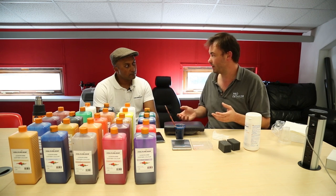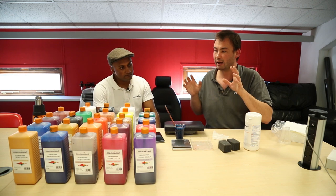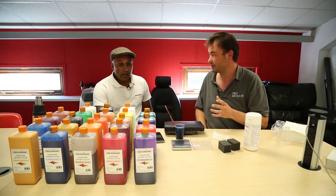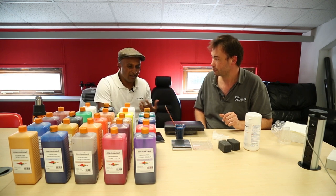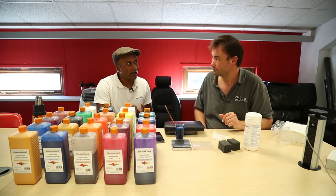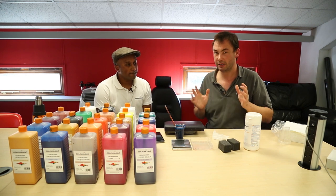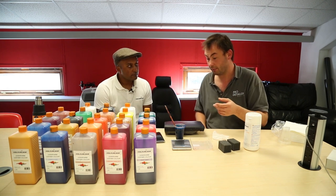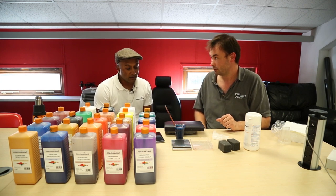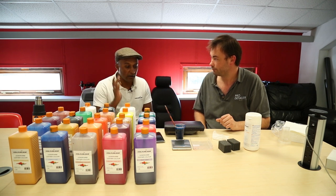What we're looking for are tools like decent scales, the app, and the consumables that work easily and well together so you can pick it up quickly. We did a shoot with Kevin Thurlaway — he mixed by eye with a lot of experience and he's very skilled — but it still took a good 20 minutes of adjusting to get the colour right. With the app, Ram mixed it by weight in about four to five minutes. If you've done the training course and need to fine-tune, add another five to ten minutes to reach a hundred percent match.